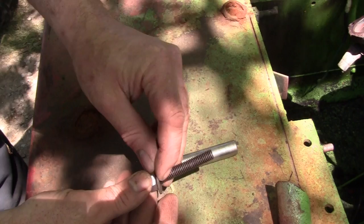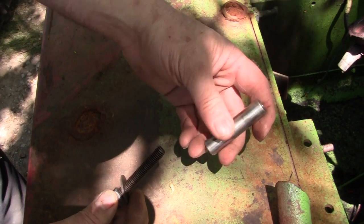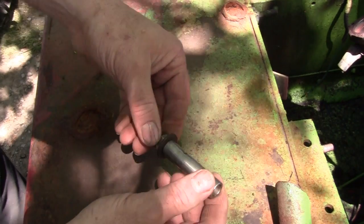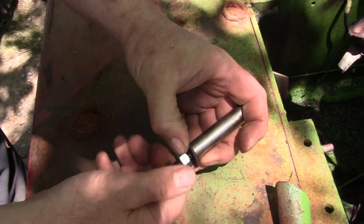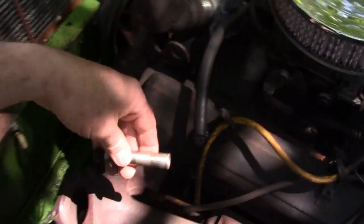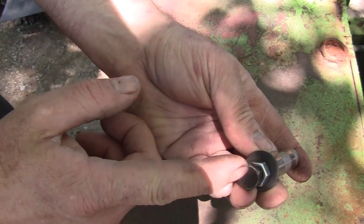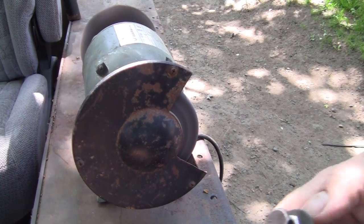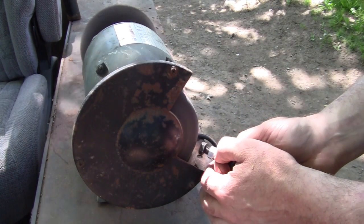I just ran the bolt down, put the washer here so it doesn't bind against the tubing. I like to use this slider pin part because it's really hard. Stick it together like this — when you take your two wrenches and open it up, it's going to push apart the manifold down inside here. Now we need to do a slight modification so it doesn't slip off: we're going to grind a hollow spot in here. Grind a little mark in the face using the corner of the grinder stone. Be careful — you should have gloves on and goggles and all that good stuff.